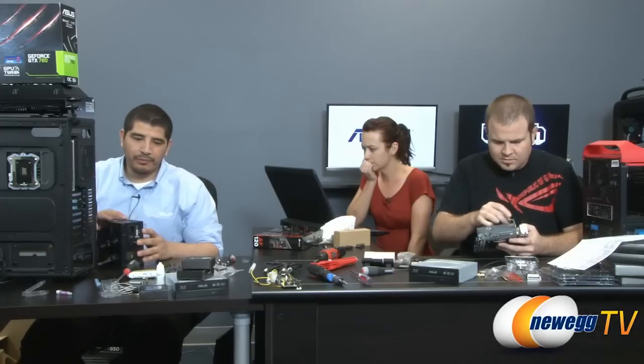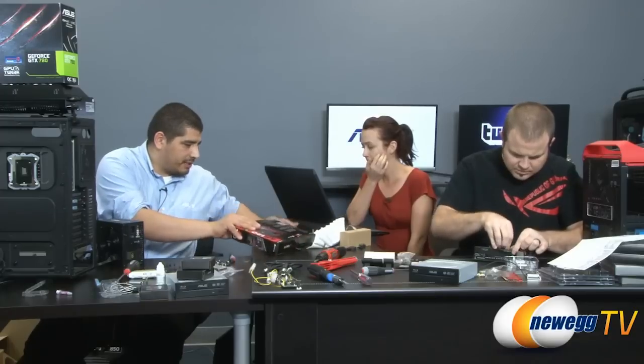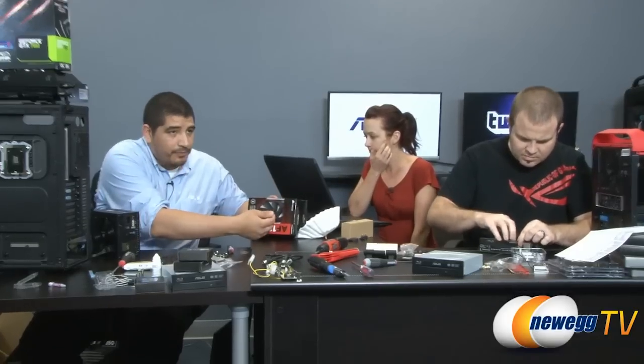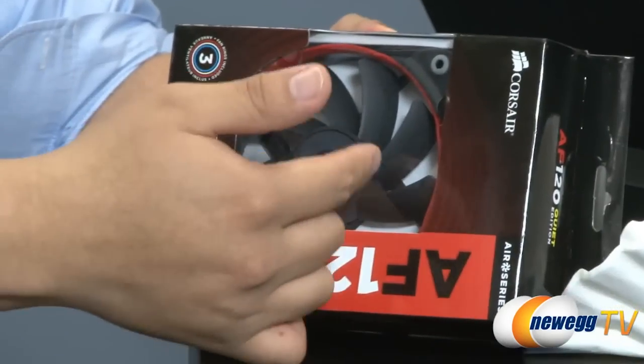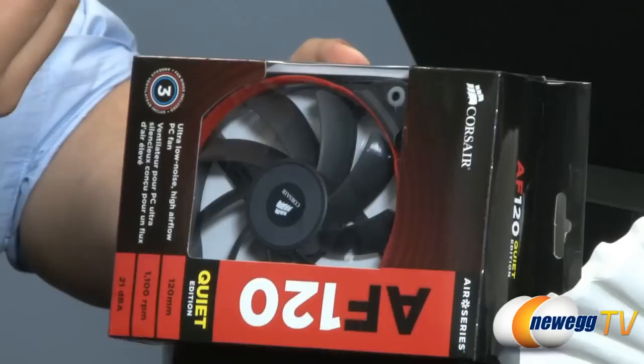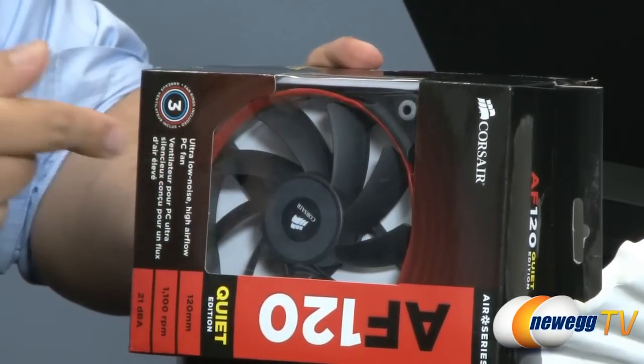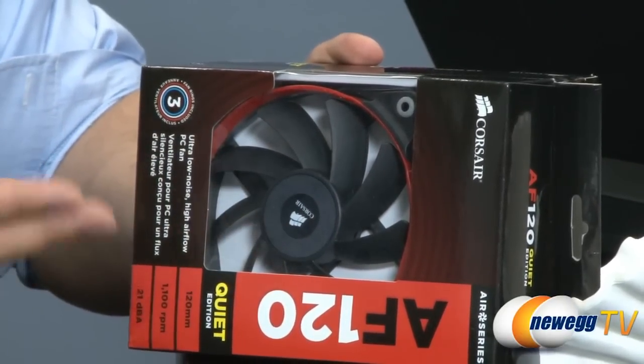Because what a lot of people don't realize is, if I use this fan as a reference, when dust comes in it can settle inside the hub assembly. It sits in there, and that can eventually stop the fan blade from being able to move and rotate. That's generally impossible for you to service.